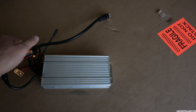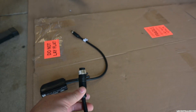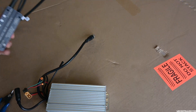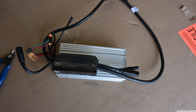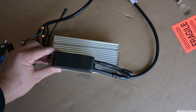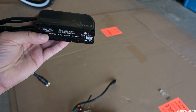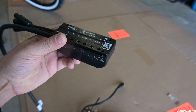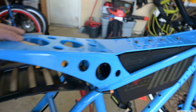There aren't many wires — it's actually a pretty clean setup. The original motor wire that was connected in the back uses the same exact connection as the new controller, so it's going to work out perfectly. The Phase Runner controller is way smaller than the stock Zeus controller. The only downside I see is it's going to overheat quickly, but you can add heat sinks — it has bolt holes on all four corners for that.